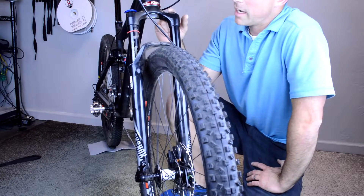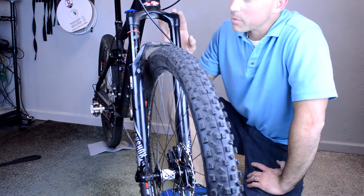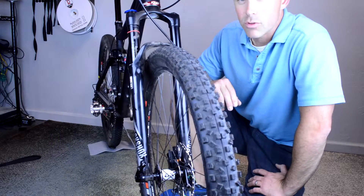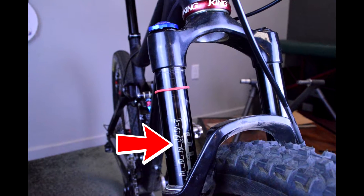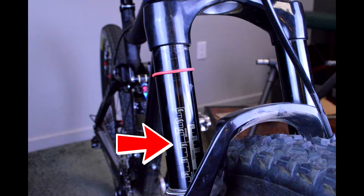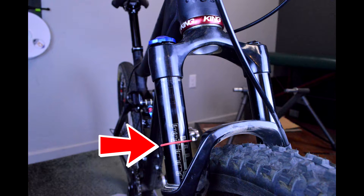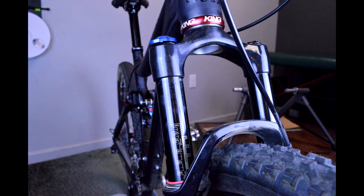For setting fork pressure, the simplest thing to do — and it works reasonably well for most people — is to adhere to the manufacturer's recommendations. There'll be a decal on the fork where you can look up what shock pressure to run based on your weight, and it's a pretty reliable way to go about it. Some manufacturers even print recommendations directly on the fork stanchions showing 10, 20, or 30 percent sag. You do this the same way as the rear shock — sit on the bike, adjust the o-ring, and see where it's pushed to. The best approach, though, is trial and error: start a ride with the o-ring near the seals and see how much travel you use.